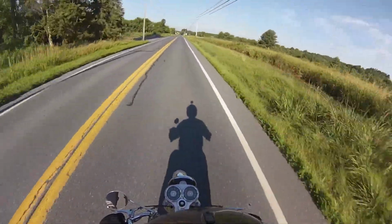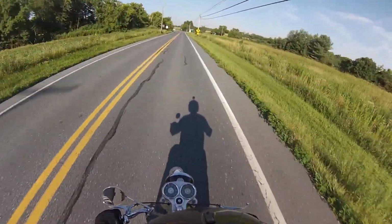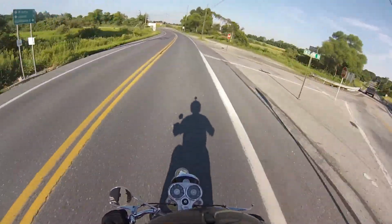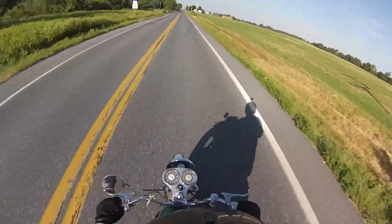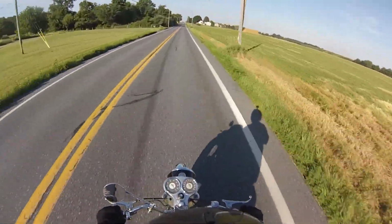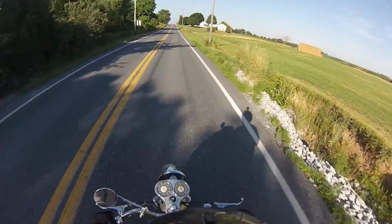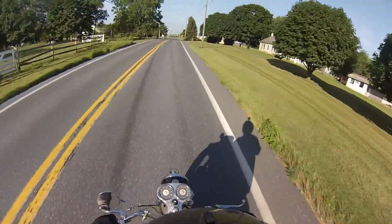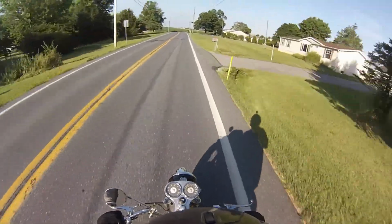Alright, so lastly, the brakes. Now, everybody complains about the brakes in these old British bikes, and they're terrible and they don't stop very well. And it is true that they are not good by modern standards. A lot of the problems with these brakes is that they don't get set up properly. The front leveraging on the twin leading shoes really has to be set up correctly. Your pull and your cable, the angle with the lever has to be correct. I'm not going to explain how to do that right here because you need audio visuals, but once they're set up properly, they work adequately.